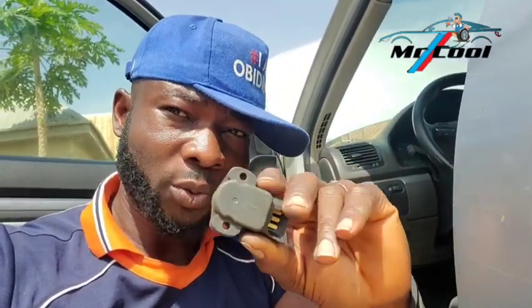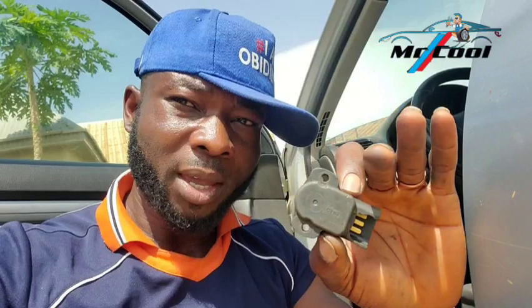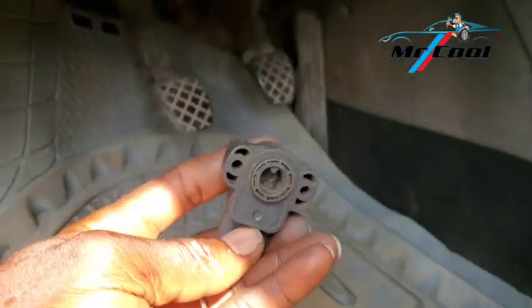The fifth symptom of a bad throttle position sensor is poor throttle response or hesitation upon acceleration. When you're having a bad throttle position sensor, it's going to be lying to the ECM. When you're stepping hard on the pedal needing fuel, it tells the ECM you need low fuel. Even when the right air quantity is there, the injector pulse width is not going to be increased, creating a lean mixture and poor throttle response.